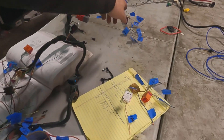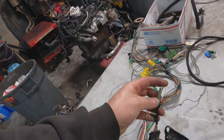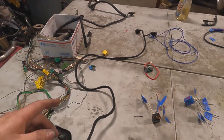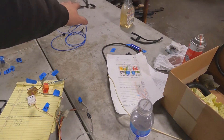The fuse box is already down so I'll know I have plenty of room for everything. If I ever have to pull the fuse box out for any testing I'll have plenty of room — it won't be too short. I'm going to run the wires through here and then connect everything. I have six wires to connect. This blue plug has all the gas pedal stuff, so I'll have to run those wires plus the brake light wires and the clutch wires — a decent amount of wires to add through this little harness. I'll make them real long and terminate them inside the car. What I really want is to get the engine harness in place and then tape everything up, finish the wiring on the inside, and then power everything up.